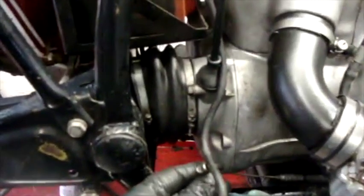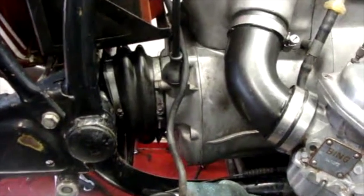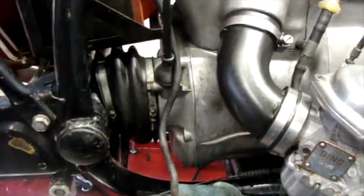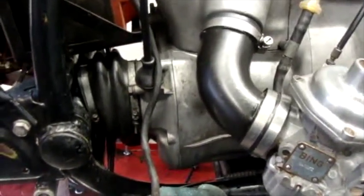When you're doing these cables, just put a little grease on the barrel that sits in here, just to give it a little lubrication because that's always moving back and forth. And the same with the clutch cable down here at the bottom — put some grease on that barrel before you slide it back in. That's pretty much it on the cables. Thank you for watching these videos. I know it's going to be broken up a little bit because I was doing the final drive and the oil fluid change on that. I will have more videos on this bike. Please like and subscribe — I really appreciate it. We'll see you next time.